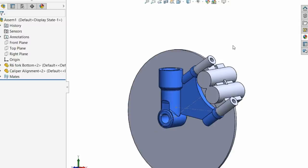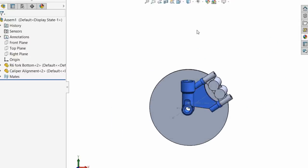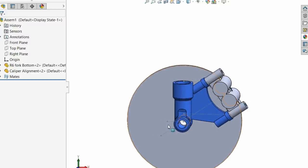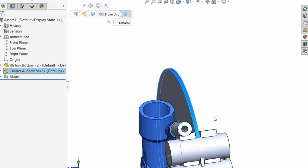The other thing is brake lines and stuff like that. Once I've got that all sorted out, and obviously this is at an angle, but we don't care about that, we can do this upright because what we're doing is a comparison. I'm going to make a very quick basic CAD model of the fork leg, the end of the fork body, how that mounts to the caliper, and where the caliper and the brake disc for the XJ sit. Then I'll have two assemblies, and in the next video I'll put the discs in exactly the same place.